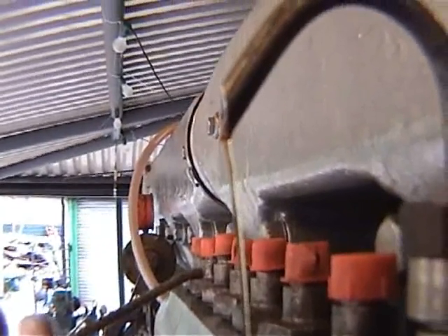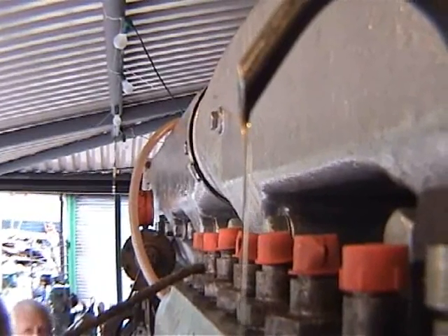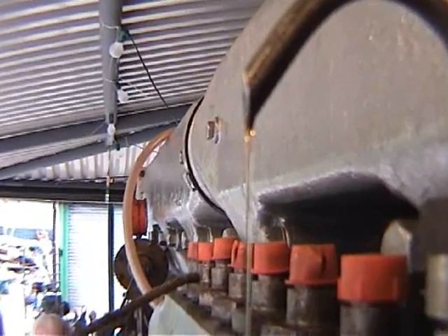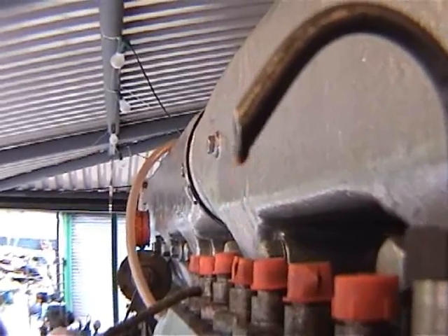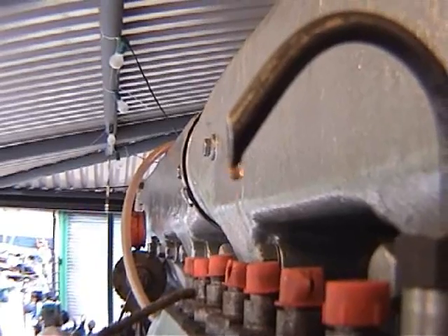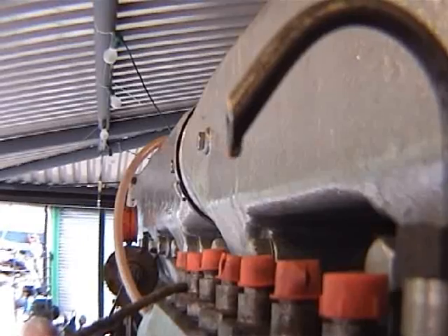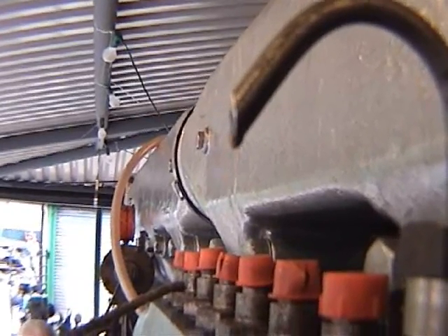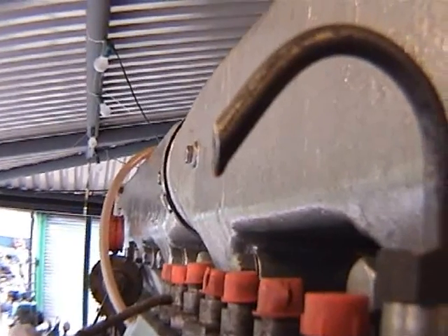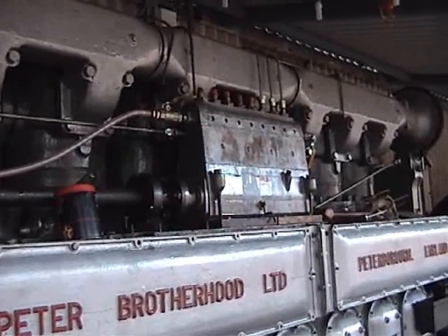The flow is slowly decreasing until it stops — just a touch more. And as you can see, that is spillport closure. The plunger is lifted up and has covered the ports where the fuel goes into the plunger, prior to delivering fuel to the cylinder.